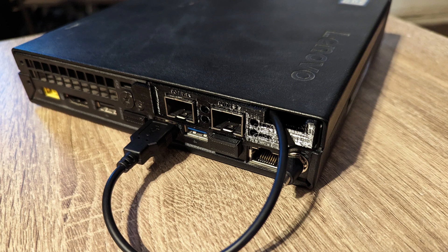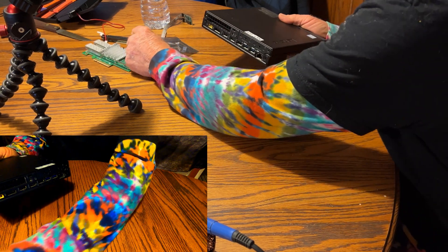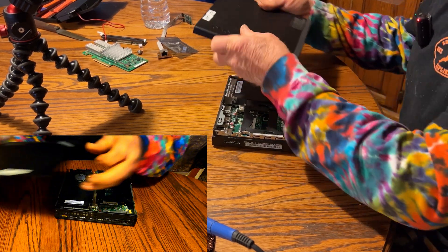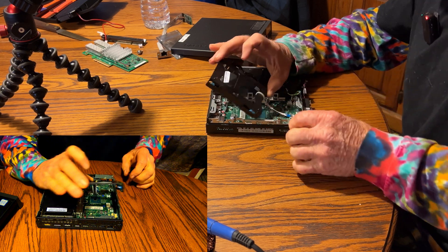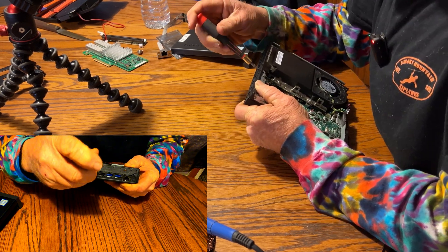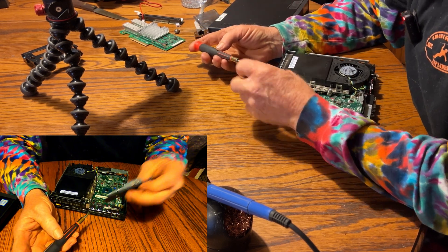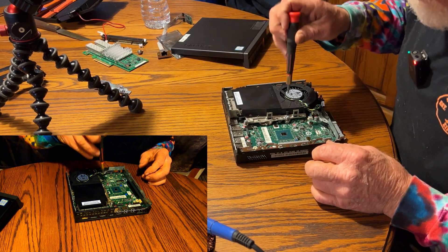To install that we need to add a 5 volt fan connector that fits this fan to the motherboard — there's also a USB version but it's usually out of stock. First thing we've got to do is get the panels off. I added a big thumb screw in place of the Phillips screw just to make it easier. We'll take out the SATA carrier — don't need that — and take off the little rear plate. I'll take the CPU fan out of the way.